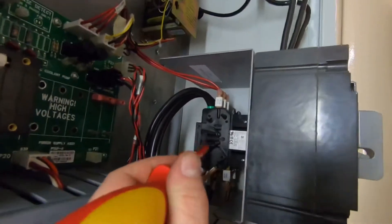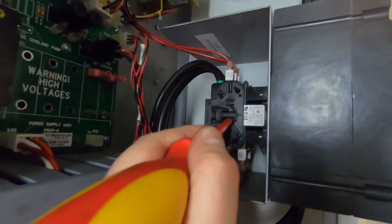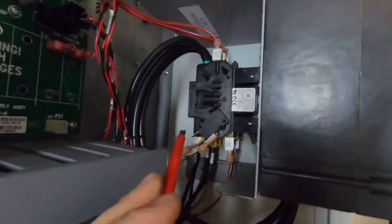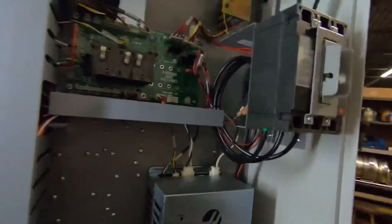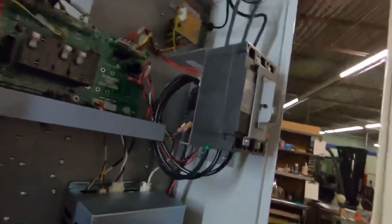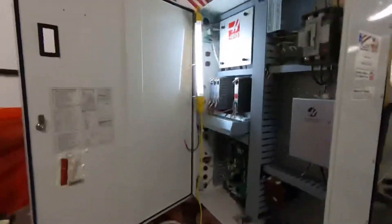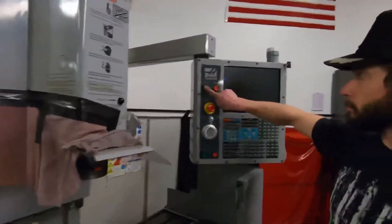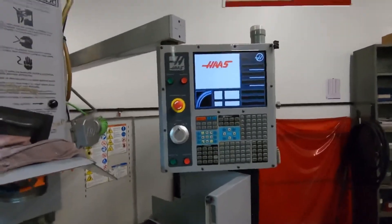And what it is — you got your little micro switch here. On here you'll see this is supposed to slide, and it does feel sticky. It's supposed to hit that micro switch right here and allow everything to turn on. Let's go ahead and hit the main breaker back on the panel box and see if this allows it to fire up. Alright, turn this main breaker back on, come on over to the front and give it a push — and like magic, we got power and she's back up running.